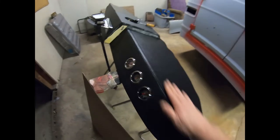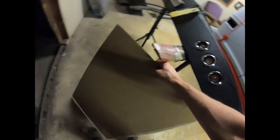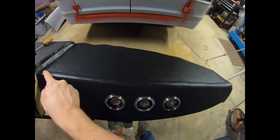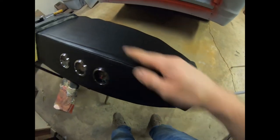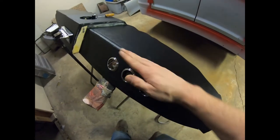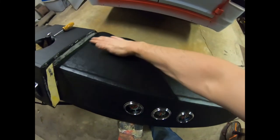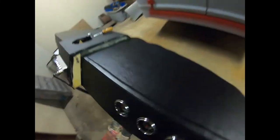So I was able to cover this edge, and then laid this piece over here on the floor, and then laid the cardboard down over it. So we left ourselves about 1/4 inch, 3/8 of an inch, and I glued that. Pulled this up, let them set, and I carefully held one in here and one in here, and lined the two glue edges up together. And you can kind of see it through here where it folded under. So it basically goes around and goes in, and that end part is what's glued down. And then I folded all this back over, pushed all the air bubbles out, tried to be very careful before we stuck it, and then we have a nice flat surface, okay?